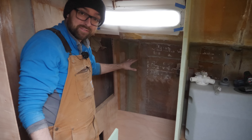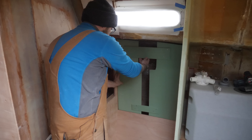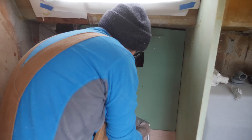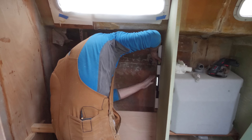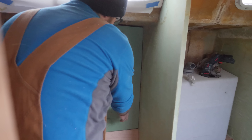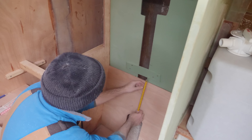Let's get back to the supports for the shelves in here. I've already put in place the support for this side over here, so now I can use my handy dandy foam template here to figure out the position for the other side. Somewhere right around here should be perfect. Let's just double check that with my handy dandy digital level. This is of course not glued in place yet — this is just a little bit of a sanity check to make sure everything looks right before I do something that's very hard to reverse. I want to be able to open these two cabinet doors even with the seat for the head raised, so I need to take that into consideration when I put the supports for the shelves in place. I'm okay having the bottom shelf be a little bit below the opening into the locker, so let's just put it a few centimeters above this.